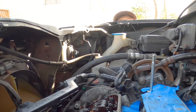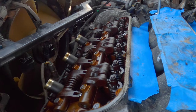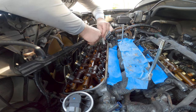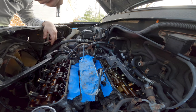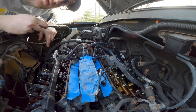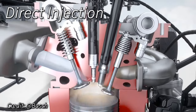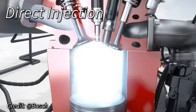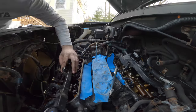I'm in the passenger wheel well turning the crank pulley, which properly aligns each set of valves for adjusting. This whole process was a little confusing at first, but there are a couple of really great videos on YouTube on how to do this — I'll link them in the description below. In general, the exhaust valves have a tendency to tighten over time and the intake valves tend to loosen. The exhaust ones are set to about 0.25 when they should be 0.28 to 0.32. Basically I'm making sure the intake and exhaust valves have the proper clearance so the engine can breathe correctly. After getting the hang of it, it was pretty simple — super easy to do, and you can do it too.